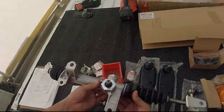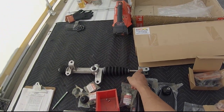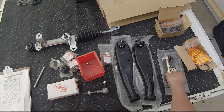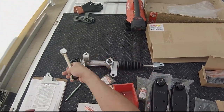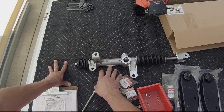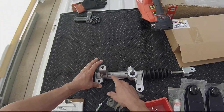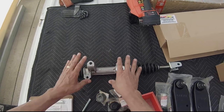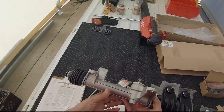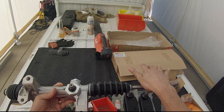Now, you may notice, anybody who has an eye for detail, it took me a while to figure this out until I read the description in detail. This connection point is on the wrong side for this vehicle. Where this connects to the rest of, I believe, all these parts, it's on the left or passenger side. In the description for this, they explain that you're going to receive this because there are vehicles that have it on the right. However, what you have to pay attention to is all this geometry here, how this all mounts to the body, where this mounts to the steering column, where this port is. And it took me a while to take pictures and lay this out, and this is the correct geometry, this is the correct part, except this is on the opposite side.